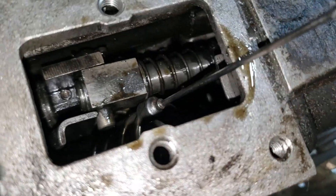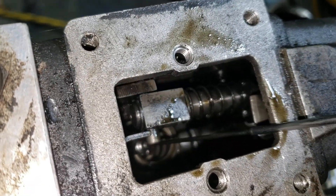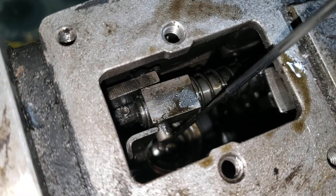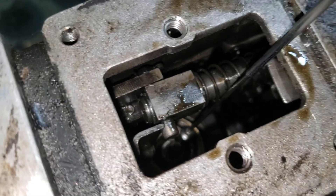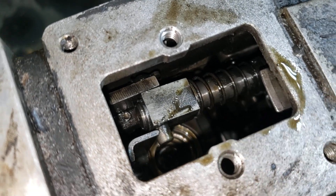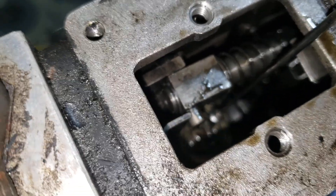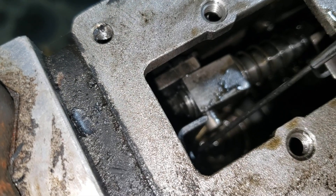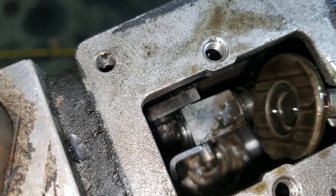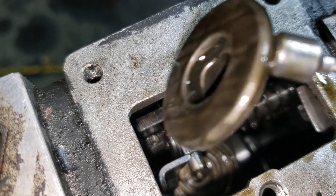There's our large spring - you can see we're using this magnet to fish it back down the hole and back into place. This seems crazy to do but it will save you a ton of time versus trying to do it the other way, and it is much faster when you're not trying to record yourself doing it. You just take the magnet and flick it sideways to break the suction on it. Then stick it down in there, kind of fish it down, hold it against the center stud and flick it sideways. Then we do the top nut in the same fashion.